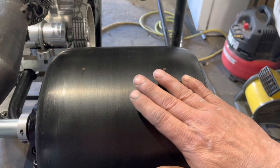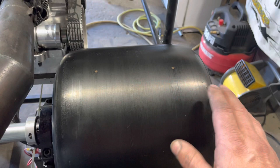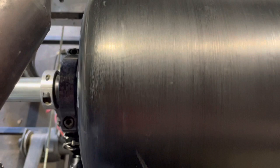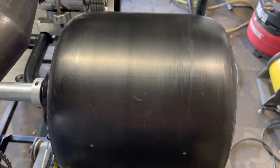The G-forces are going to squish down and push, and the inside is actually going to balloon up further than the outside. So this edge is going to go away. This tire is right on the verge — I'm probably going to flip it just to get the edge back to looking decent enough. So we're going to jump over to my bench and I'm going to show you some tire wear.